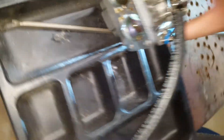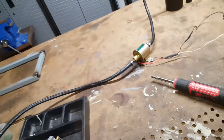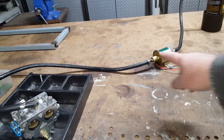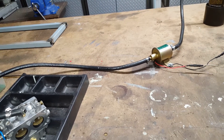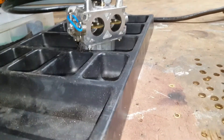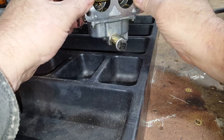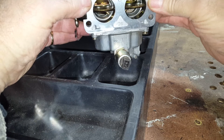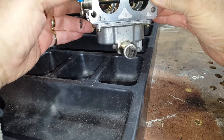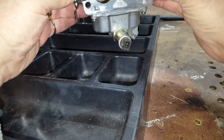Can you see if it's in the back of this area? Let's see if the gas can get — excuse the break there, too many bad clamps. Took the filter out, put this back on. You can see it pumping, banging away, and then down in here — let's take a look, see if we can see anything going on in here. I don't see any gas being pushed past.